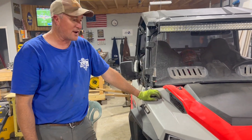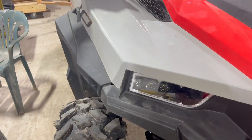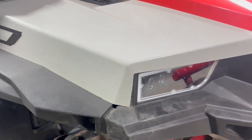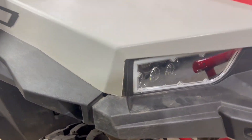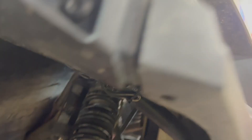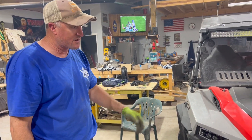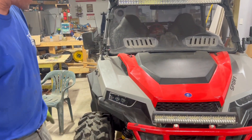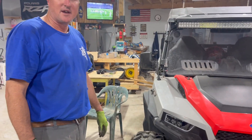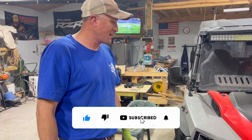We tried putting more preload in before and that seems to have worked. In the process they also replaced the headlights — we'll put a link in the description below; it's only three bolts to get the headlights in and out. We also apologize if it's a little smoky — we've been welding up some tree kickers for the blue donkey. So there you go: new 300-pound lower springs replacing the 275s, hopefully solving the problem of those big 370 tires bumping up and tearing the lights out. Please like and subscribe — it keeps us motivated to keep putting out these videos. Happy trails!